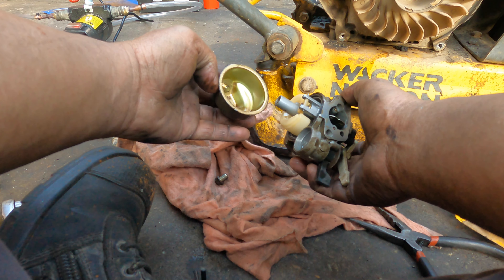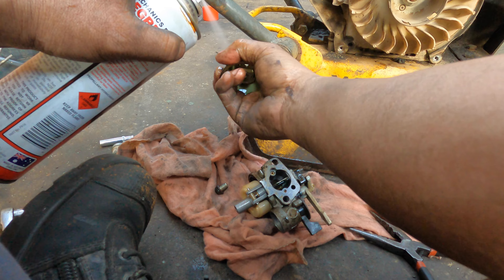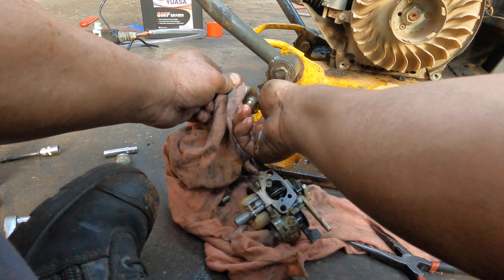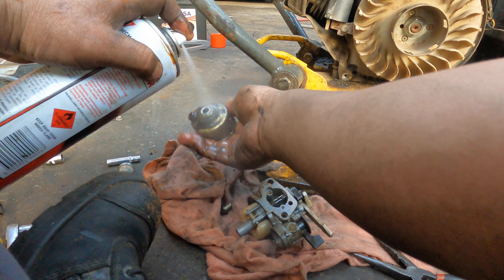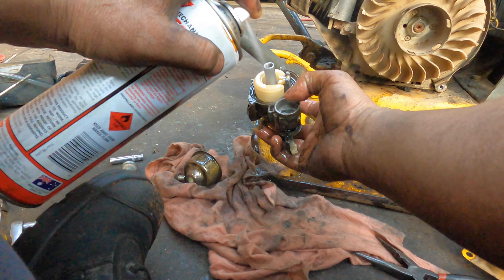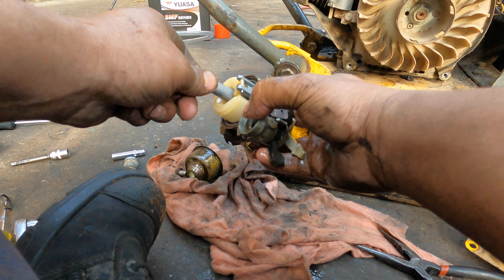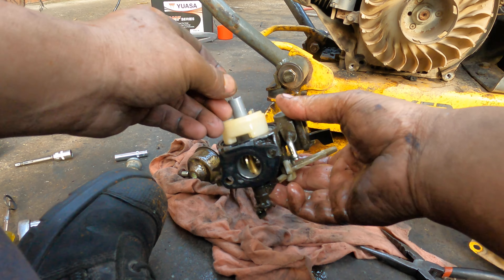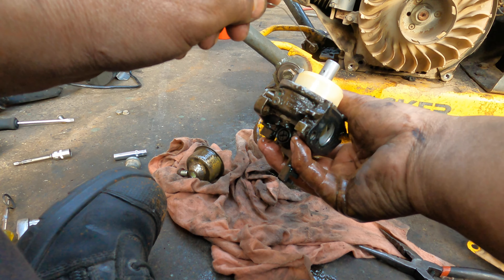If you see water in the tanks, there should be water in here too. Tackle it with your degreaser if you wish, or petrol if you wish — whatever you can do here, you do. I'm too lazy to get up and down, getting too old. This is called super service — you don't just do a normal service because you don't want the customer coming back the next day saying you're a bad mechanic. In the needle, use a fine thin steel spring from a set, get it out, and make sure the tiny passage line goes through. Done.